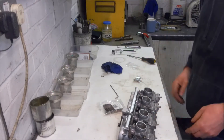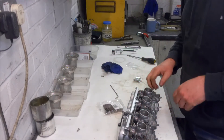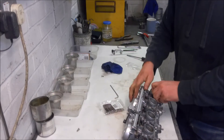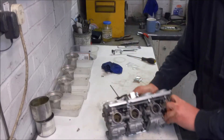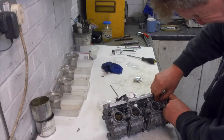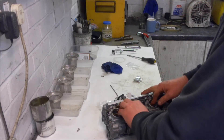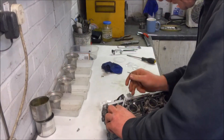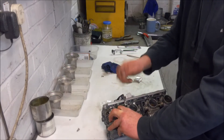That all snaps together and now for the really really horrible fiddly job, and that is fitting the little springs that go on the actual carb adjusters. There is no easy way of doing this - it's just a case of holding the carb butterfly open with your finger and then wiggling them into place. Slacking off the adjusters gives you at least half a chance of getting them in. There are actually little tangs - raised parts - on these that the springs actually sit on.